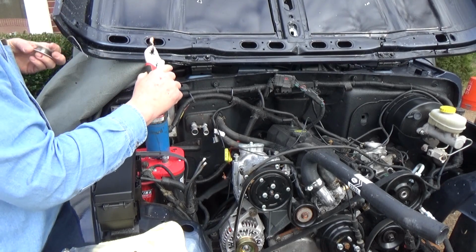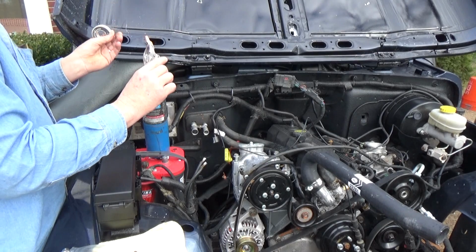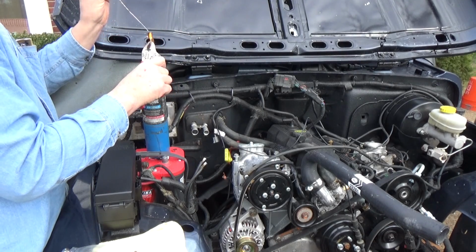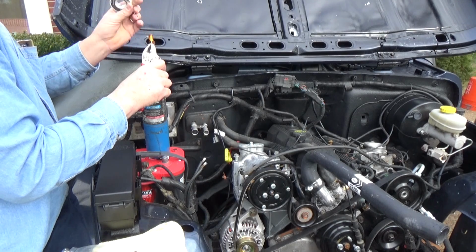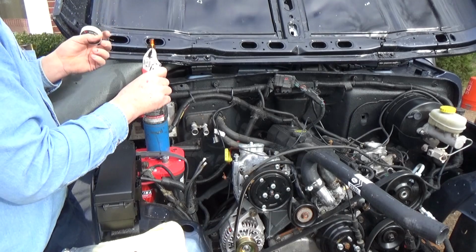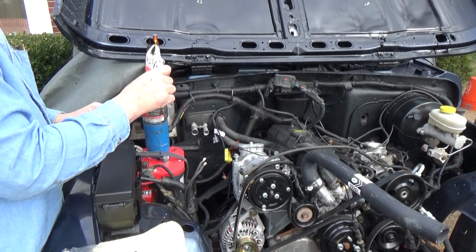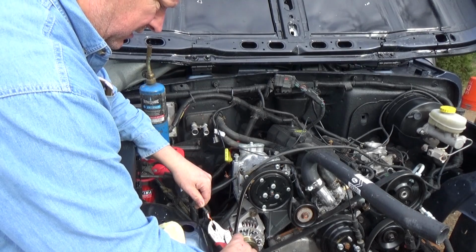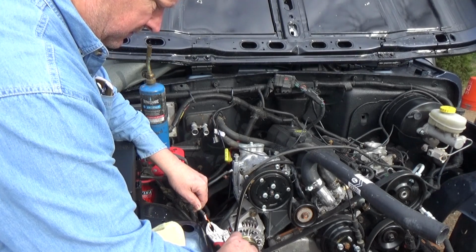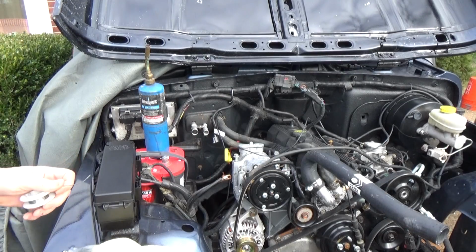So you're just going to heat up that lug, which is made of copper. And when it gets hot enough, it'll melt. And these are crimp-on lugs, but I've always just done it this way, and I've never had any problems. Because there's no gap or anything. So I got it full, make sure it's good and hot, and then I just take my end, stick it in the solder, and I let it cool for just a minute. And there you go. I'll do the other negative side real quick.